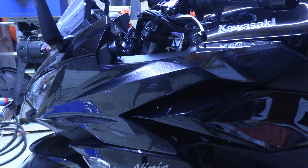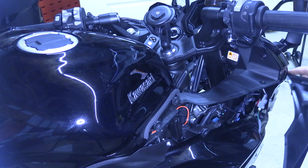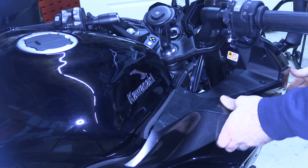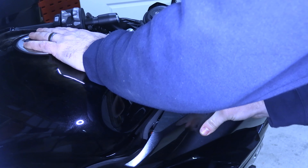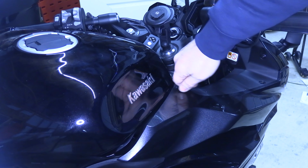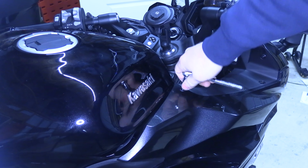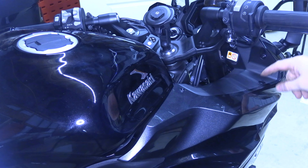On the right-hand side of the bike, same process for the middle fairing. Line all the clips up at the front, pull it back, and push your grommets in — you have one down below and two up top. Then take your bolt, feed it in, use the 4mm hex socket, and tighten it up snug — not too tight. Take your push tab just like on the other side, make sure the piece is out, push it in. Done.